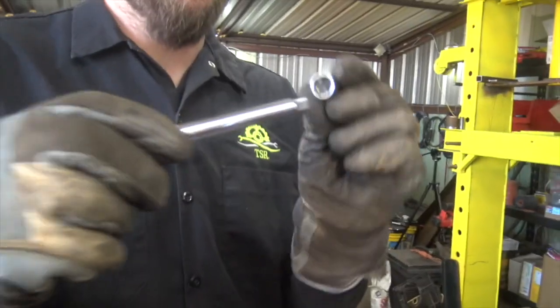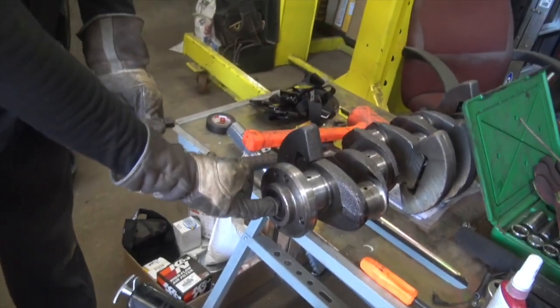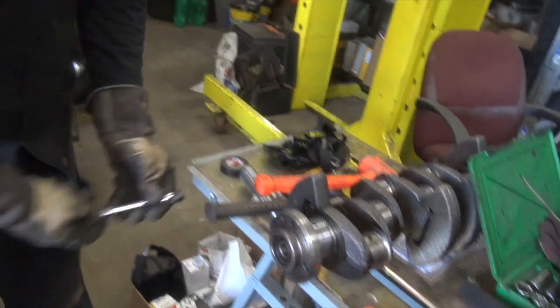Take your extension, stick it on the inside of the socket like this. What we're going to do is pump grease in here and hammer on it — that creates a little hydraulic ram effect.